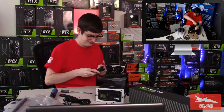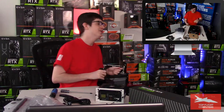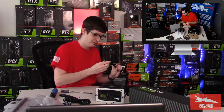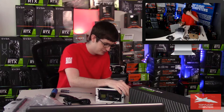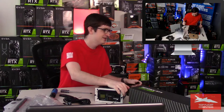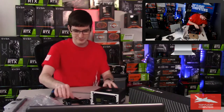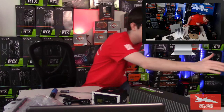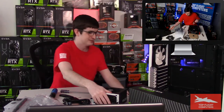I mean, truthfully though, the easiest is the AMD stock cooler. It's literally just clip down, and you're done. I can argue Intel's is even easier on their stock cooler, but they don't really include those. Well, that one you gotta push in four pins, though. They don't really even include those anymore. No, they don't. Because he got an i5-9600 and he didn't get a cooler with it. They only include them on the i3s, I think. Yeah, the Celerons and Pentiums that are way at the bottom.